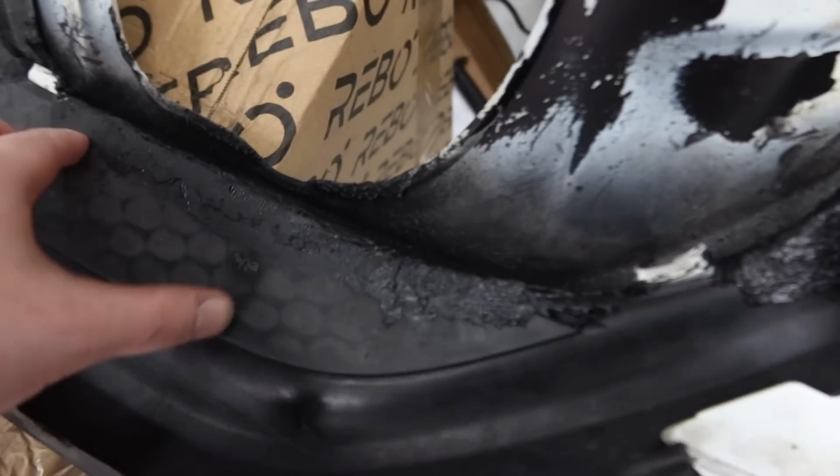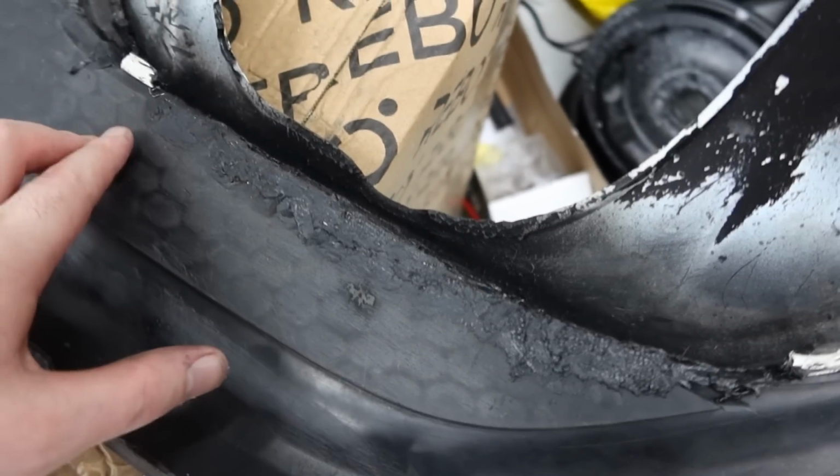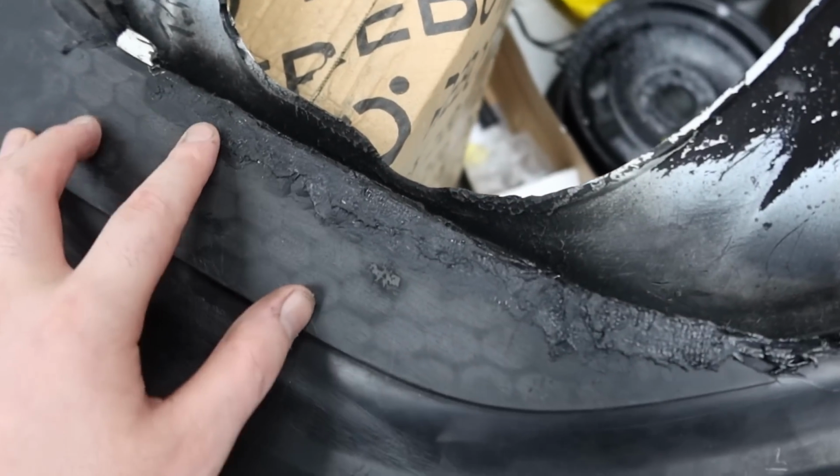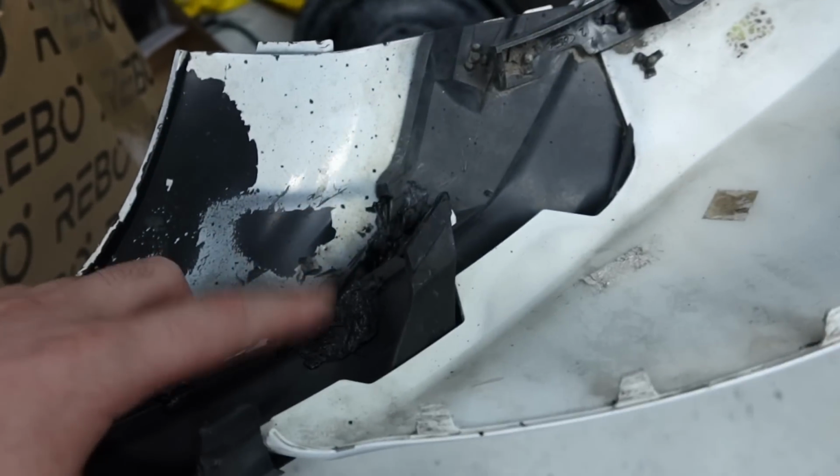The back side, all I've done, as you saw, is I put a long mesh plate along here. I welded that into the actual plastic just here, and then on top of that, guys, I put the fibreflex just to give it an extra thick layer so it doesn't go anywhere. And I put another bracket just here, the mesh bracket, and then one last one just back there. So that's that for the rear diffuser now. We do need to prep it for paint, but I'll do that afterwards.